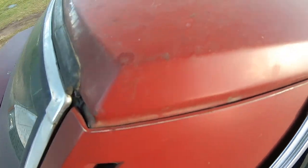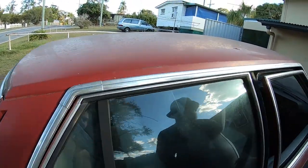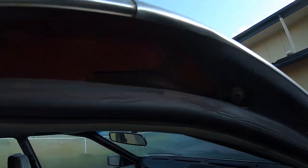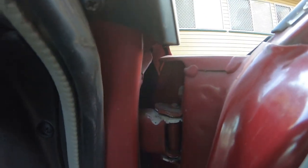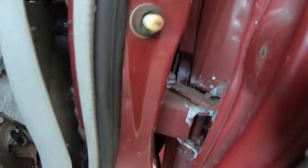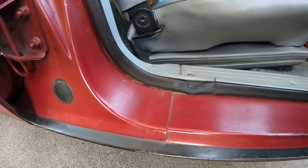Check the front, check the pillars. Open the driver's door once you've checked the roof — go around the roof. When you're at this part of the car, open the driver's door and straight away check up at the top corner there. Funnily enough they do rust in these edges. Go down the pillar, check around the hinges, and also look for any cracks. A very important thing on these older cars — particularly even the later models — is if you see any hairline cracks anywhere around the hinges or the frame, that's trouble, big trouble.